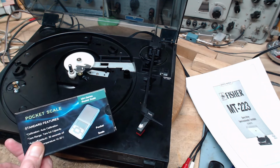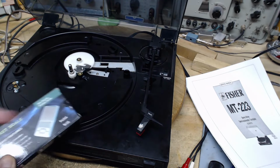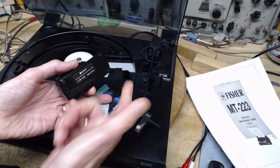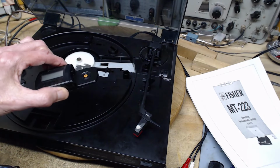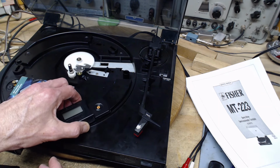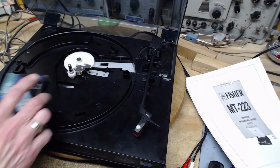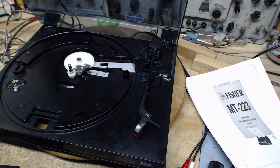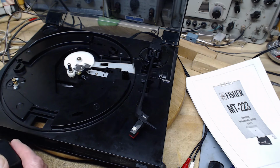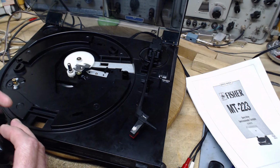I do have another scale here, but this scale is just a regular scale. It's not meant for measuring cartridges, and the problem with it is it's fairly thick. You put it down, it's just too thick. So this is an actual proper one. You see how thin they made this. So you can have it at the height of the record. It has to be at the height of a record. If it's too high or too low, you don't get the right reading. And if you're really into this, that's important. If you're really into playing records, you're not doing it with this, that's for sure. This is not...